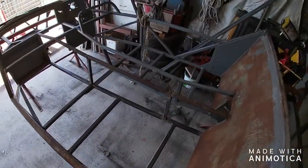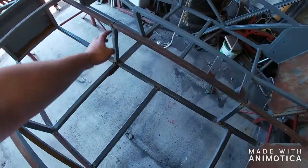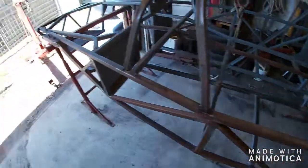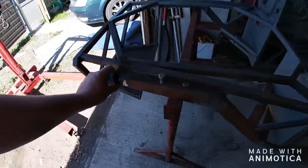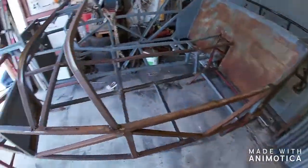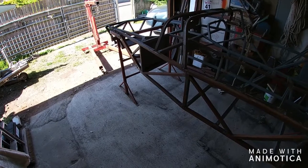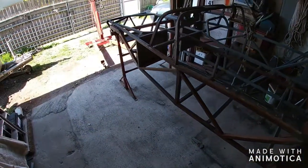Now it's the right way up you can get a better idea of what the floor looks like. These are the two seat rail support bars, and the flat bar in the middle - all these are all welded now. In places I've still got left to finish welding on that one, finish welding down the bottom - the bottom ones are done. I need to do around this one and just cap that off. If you follow me on Instagram at underscore igamogam, you'll have seen the cap I did on that one. So I'll get all these bits welded up - not that much left - and then it's just a case of sanding down this area and painting it exactly the same as I did underneath.